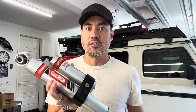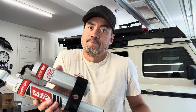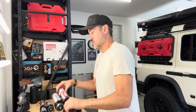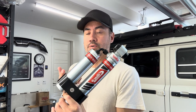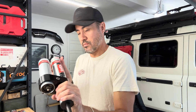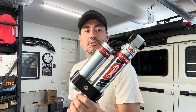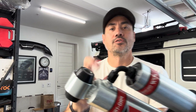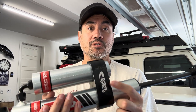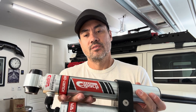They're not rebuildable, but for $250 a pop it's not bad - that's a fair cost of entry. There are two with the slanted style and two that are straight. I believe the straight ones are for the front - I won't know until I get the shocks out. They are the same length and travel. The slanted ones probably go in the back to clear the upper shock bucket. It's a pretty nice shock - it has hard tubing because it's a piggyback, not a remote reservoir setup.